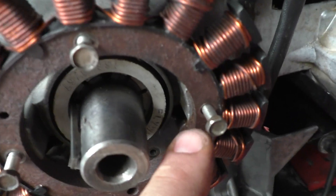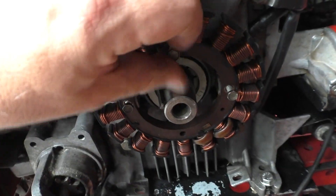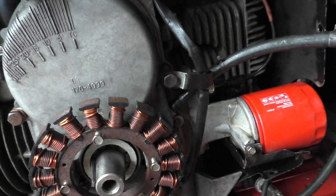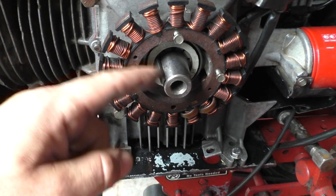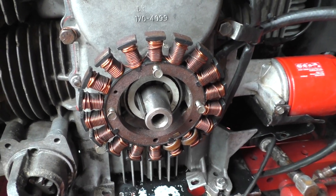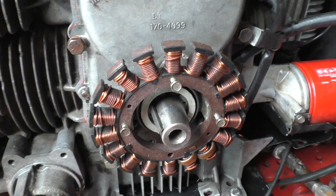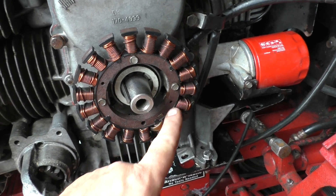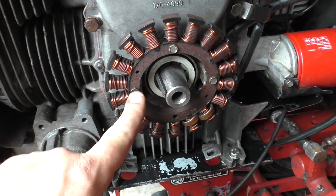Next is the stator — these are really skinny little bolts that go on here, just going to get hand tight. I had to put this one clip on that I forgot. The keyway is all set. Next we'll be putting the flywheel on — I think the flywheel is 60 foot-pounds but I've got to check. These get tightened snug — they'll bottom out, and just as soon as they're snug, use a quarter-inch drive and don't strip them.